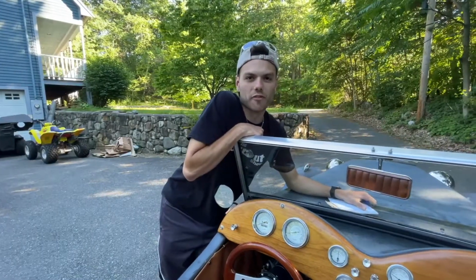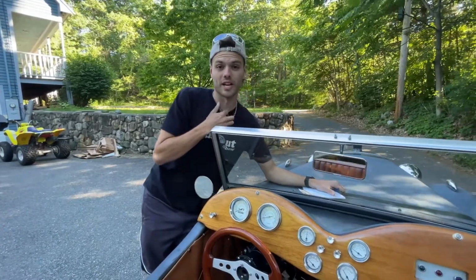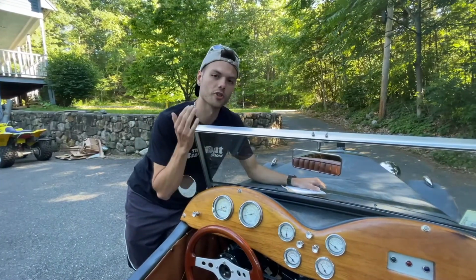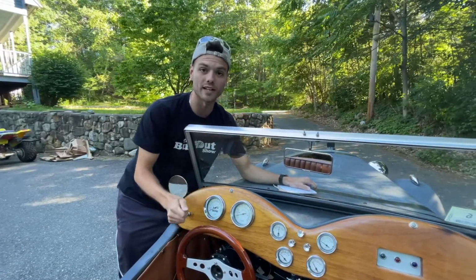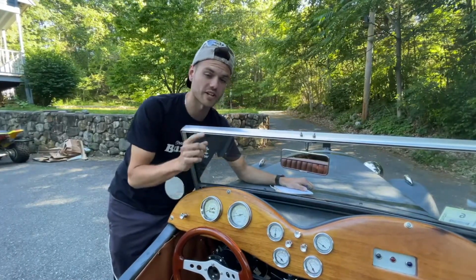As if there weren't enough problems with the interior and the MG, the gas gauge is also an issue. Now see if you can follow this. When the car is off, the gauge is all the way to the left, meaning that the tank is empty, which is natural because the power is off. Now when you turn it on, the gauge goes all the way to full. However, that's on an empty tank.